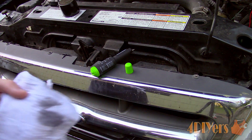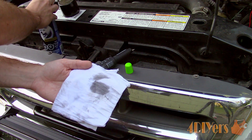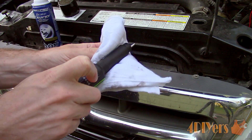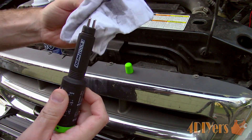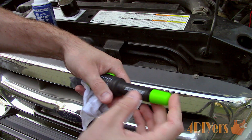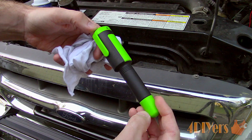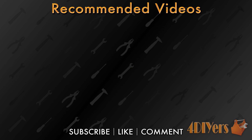As mentioned earlier, wipe the tester clean — even use a little brake cleaner on a cloth to remove the residue. Maintenance intervals for brake fluid replacement will vary between manufacturers, but as a generalized guideline it should be done at 40,000 miles or 65,000 kilometers, every three years, or under any major brake system repairs. Use brake fluid which is only listed for your vehicle; while some types may be interchangeable it's best not to mix them to be safe.